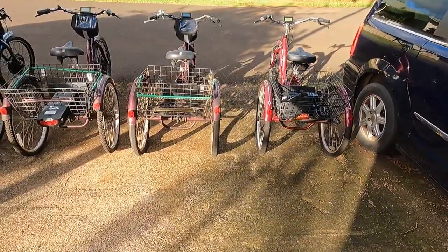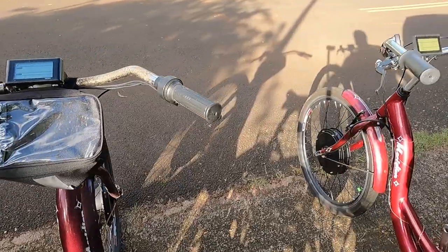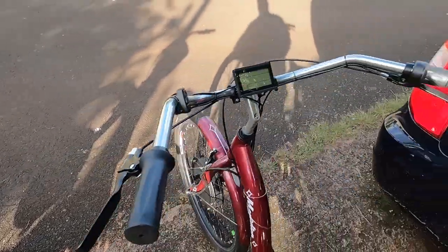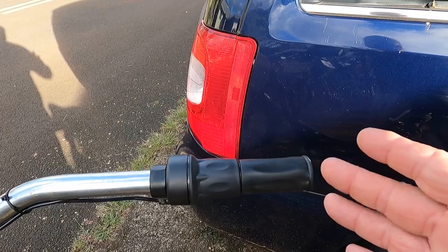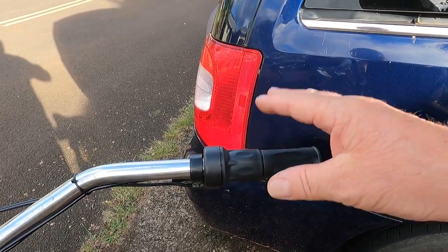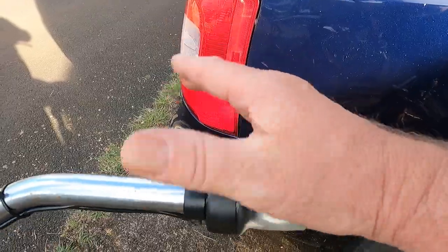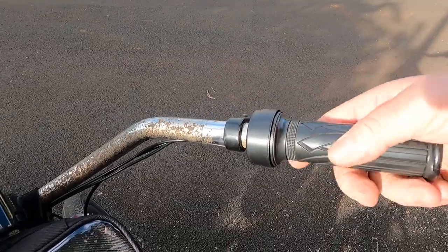After brakes and tires, one of the safety things I like to keep in mind when building an e-bike is what type of throttle to use. The thumb throttles that come with commercially available kits can get tiring on long rides. Here you can see a full twist throttle where the entire grip turns like a moped, and on this one is the half throttle where just half of the grip turns. These are safer because if you rest your hand on the end of the grip, you won't accidentally activate the throttle. I learned the hard way — the tire rubbed all the meat off my leg once. Definitely recommend the half throttle for safety and convenience.